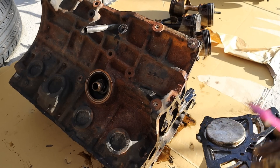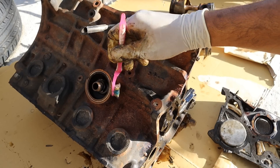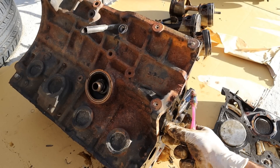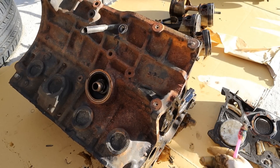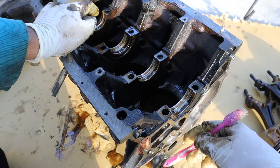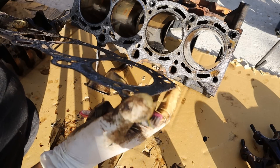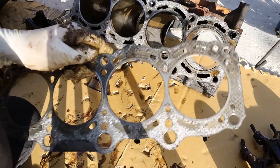That oil pump assembly sends oil through this oil port drilled into the block, gets filtered out by the oil filter, and sends it down the oil galley that runs along the side of the block all the way to the back. On this side of the block they've got a threaded insert — again from an era when things were serviceable — so you can actually unscrew this when rebuilding to clean things out. That main oil galley feeds the crankshaft through holes drilled for each bearing. Coming up from the main oil galley are oil feed holes that feed the head to lubricate its components. At the top of the engine we can see this composite gasket that doesn't have multiple layers like you'd expect in a modern engine.